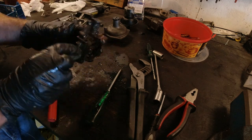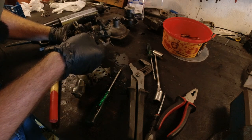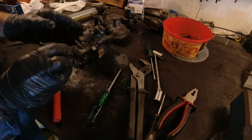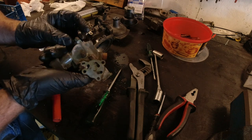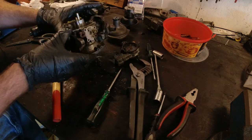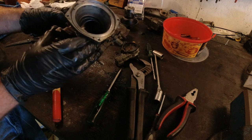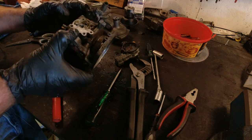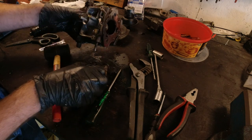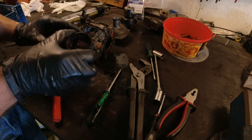That came up - I think I have that gasket, I recognize it. So that's good. Peel that back - okay, so there's fuel in there. This is just pretty exciting. This is honestly a very complicated carburetor, at least compared to SUs - but we've got fuel going there. I'm trying to figure out why - it's definitely part of the enrichment circuit. I thought the enrichment was just moving the jet but it seems to be extra fuel. I'll need to do some research.